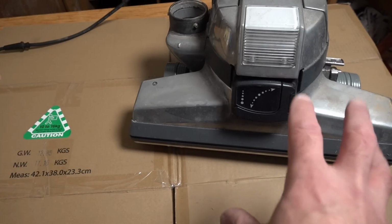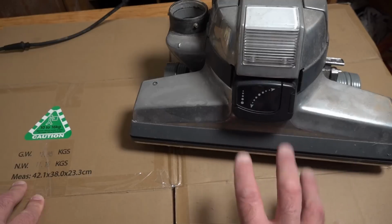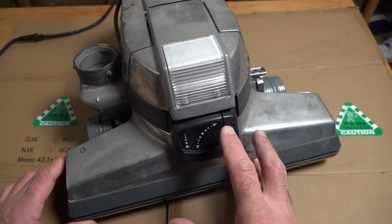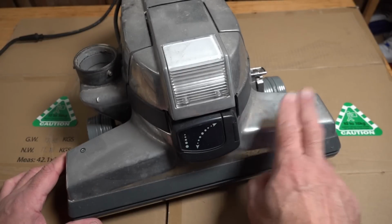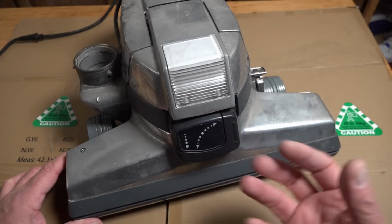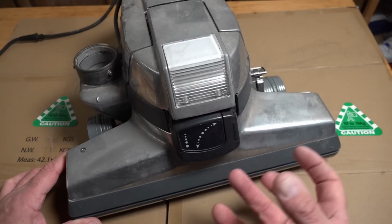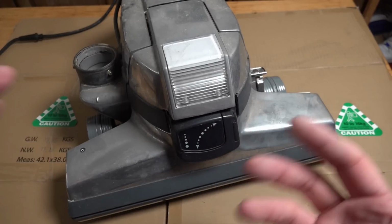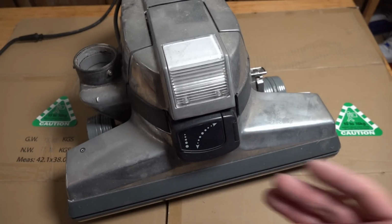So my first bit of advice is get a bit of cardboard or newspaper, either on the carpet or on a table. So we've got the Avalir, the Kirby Legend, early G series, it all works the same. The aluminium is a lot easier to polish on the early Kirbys. It's got a higher grade quality aluminium on those machines. As we progress to the newer ones, we've got less quality aluminium, so it does deteriorate over time, so you do need to polish them a little more regularly than you do the older machines.